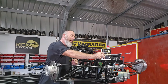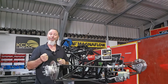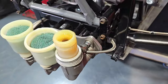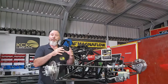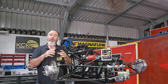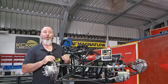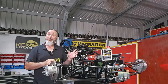We've got the brake fluid in there now. The master cylinders are full and we're just going to wait a second to make sure they don't leak. A little trick a lot of these guys use in these sorts of cars is putting a bit of foam inside the master cylinder — this is only to stop the brake fluid sloshing out of the cap due to bumps and g-forces. It shakes those reservoirs so badly that the fluid actually comes up out of the cap, makes a terrible mess and gets all over the driver's feet.